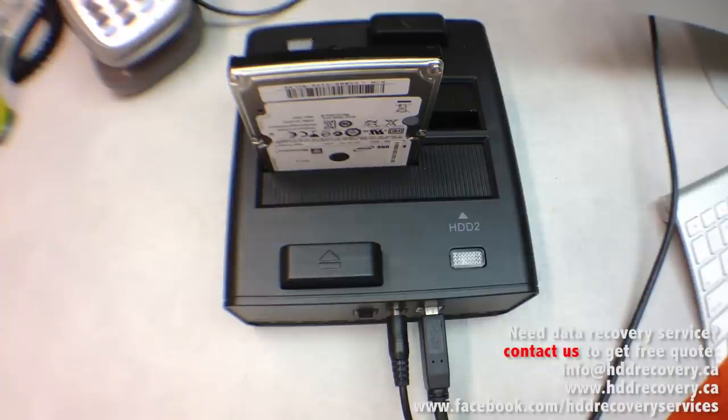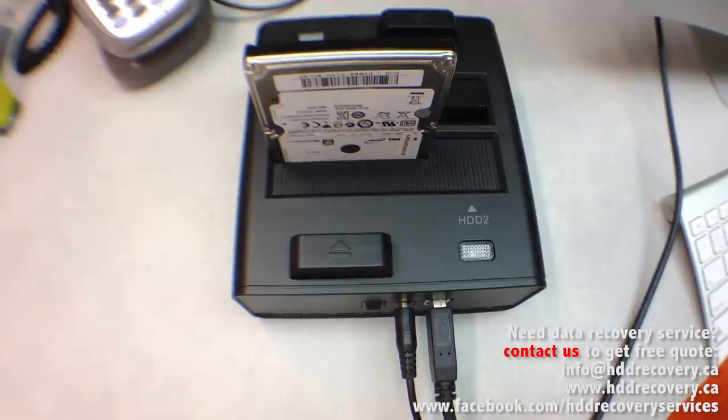What's kept on that drive is important — sometimes it's irreplaceable, and that's what we're trying to address here. Data recovery is our main goal. The next step of the process is to physically open up the drive, look inside, find out what the issue is, and correct it. If the platters are being held by the heads, we release those heads, park them back in the parking zone, and follow up with the imaging process. If the issue is related to the spindle or bearing, we move the platters into a donor chassis with the exact same motor and run it that way.